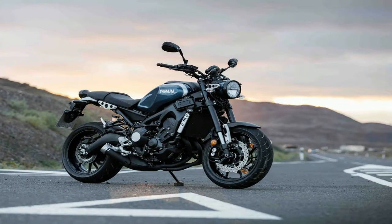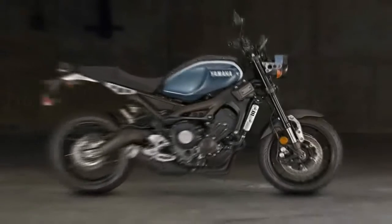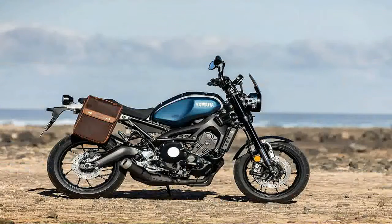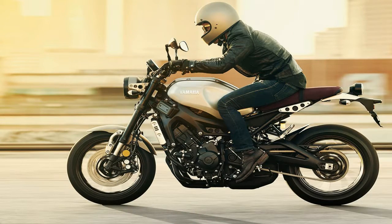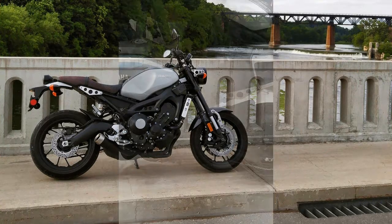A well-exposed aluminum frame forms a sort of stylized trellis skeleton, with the engine as a stressed member to complete the assembly on the XSR900. This futuristic, alien look carries right over onto the asymmetrical swing arm that features a split member on the left side to accommodate the drive chain and its guard, and a sharply kinked member on the right. The frame is certainly more ornate than usual, but since it's a naked bike with everything bared to the world, it makes sense to use the standing rigging as part of the overall visual appeal rather than simply a functional component.